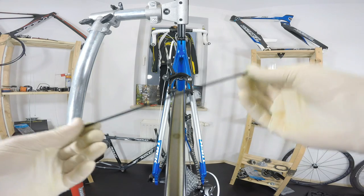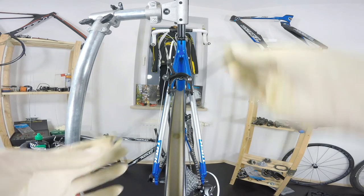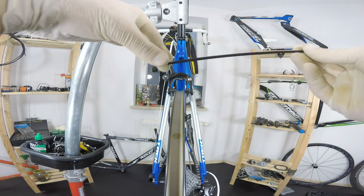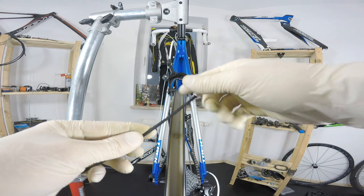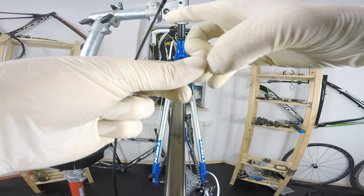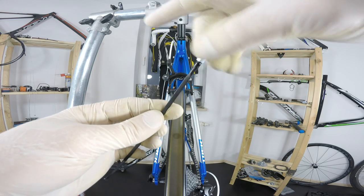Now, how the truing works, let's see the example of the spoke. This is a Campagnolo Shamal spoke, the one that was crashed, actually. But as you can see, we have the spoke, the part assembled to the flange of the hub, right? So it's fastened there. And here we have a nipple that is basically a simple nut. And this nut will also be assembled to the rim.